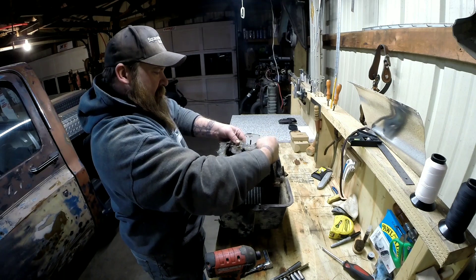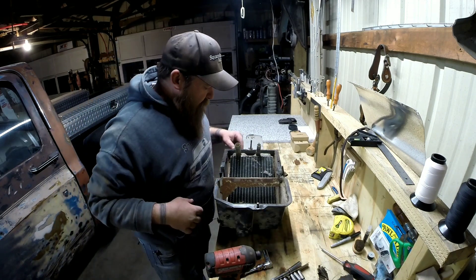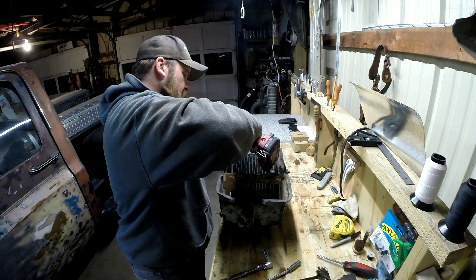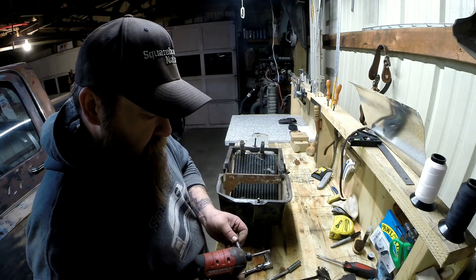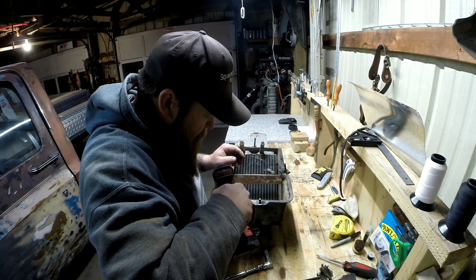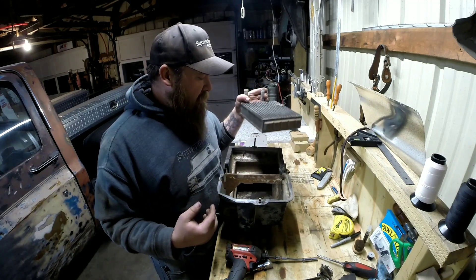A critter got to mine and tore it all up. This insulation should be stuck to your cab, not on the box — if it is, you're in the same boat I am; that's going into the trash. You'll have four retaining screws in there, one on each corner. Take them out, and then the heater core will come out. Put your new one in and go from there. And voila — there's your heater core. Get your new one in and everything is pretty much reverse of removal, nothing much to it.